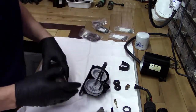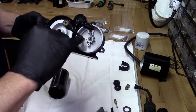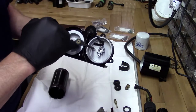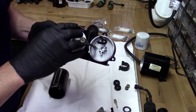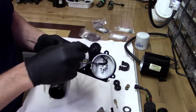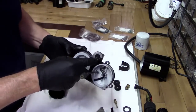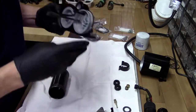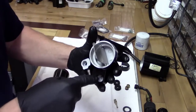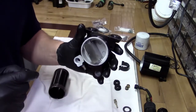There's how it looks. You can see how I cleaned this all out in here — this was all flaking real bad, and that was going to be the problem with plugging up your filters. Over here, the same thing. This would flake off, so I cleaned up this whole edge so you get a nice seat for your fuel filter. It'll fit on there and you won't have to worry about any paint flaking off and getting into your filters. You can see I cleaned this all out, got all that black paint out of there, so there's no chance of any black paint getting into your filters.